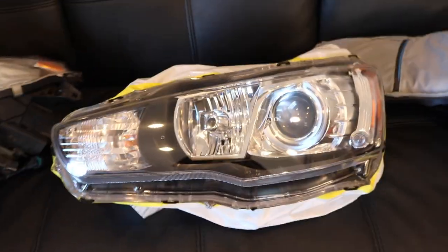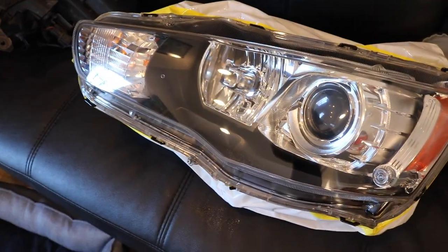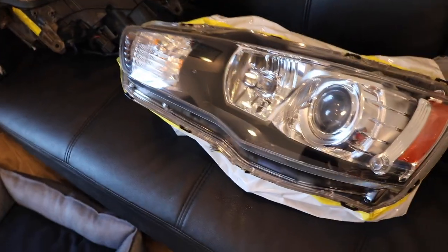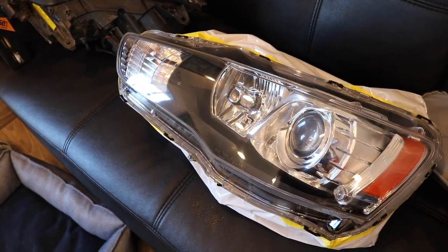That is sanded down — I de-hazed it with 1000 grit, then hit it with 1500 wet and dry, then 2000 wet and dry, then cleared it. Two coats of clear — Euro Clear HB, two to one, two medium-heavy coats. Alright, so that's it for this week. Like, comment, subscribe. Next week we will have a bunch of Evo content and we're starting this bad boy — I'm super excited. Have a great weekend and I will see you all next week on the next vlog. Take care.